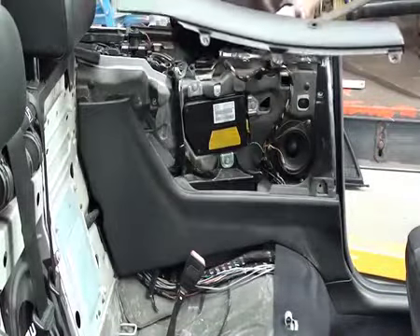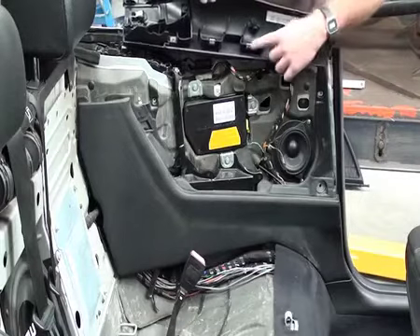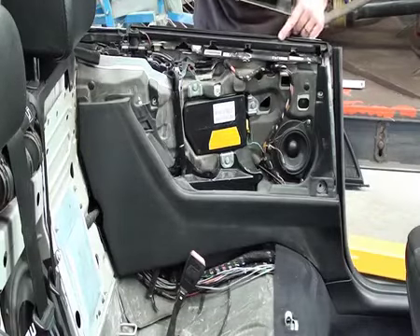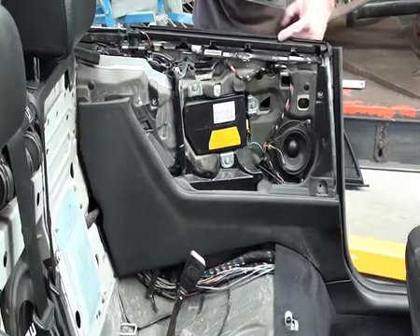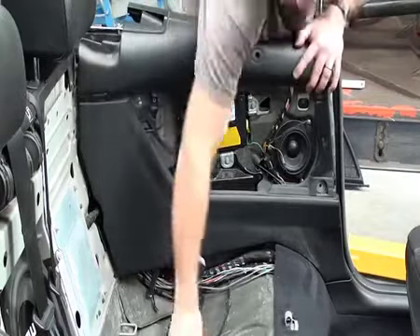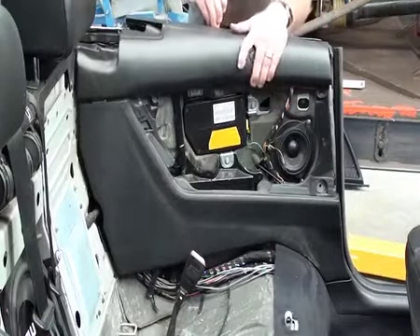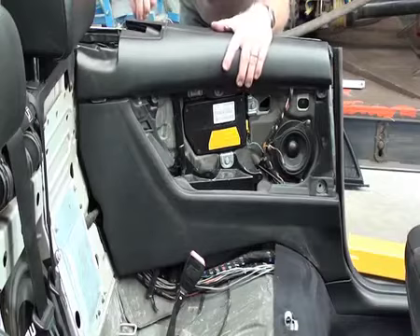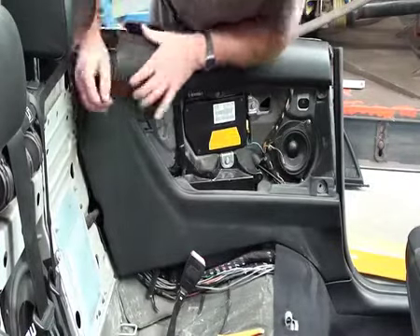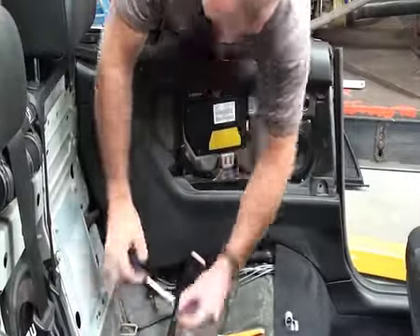The next one is this piece here, which can sometimes be a little bit of a pain. Make sure that the front part of the seal is clear. What we're trying to do is connect these on these little knobs here. Also, this leading edge here needs to fit on the inside of this. So what I'll do is line them up at the front, then use a plastic tool to pry this away as I gently feed it down. Once that's in place, this seal needs to be pulled up — you can slot that down there and everything is in the right spot. That seal along that edge there is nice and in place. Then once I've done that, I can put in those 7mm screws.